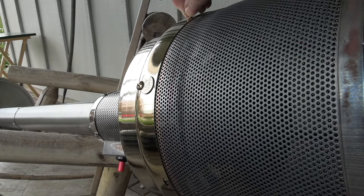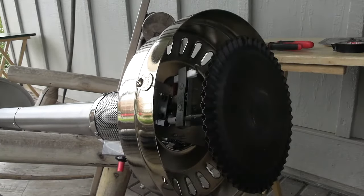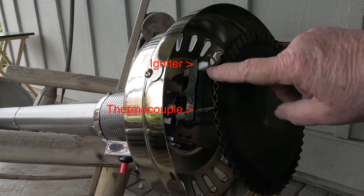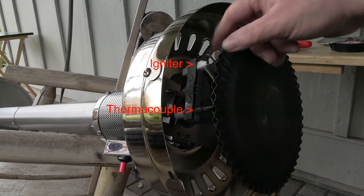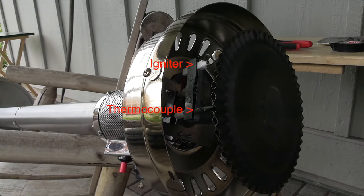Next it's just a matter of removing four screws to pull off the screen. Once you get it open you see the flame unit, and then there's a thermocouple and the igniter. The job of the thermocouple is another safety feature that will keep the flame lit as long as the pilot light is going, otherwise it'll turn off the gas.